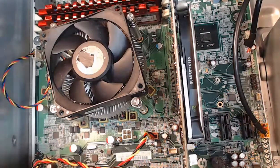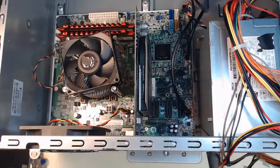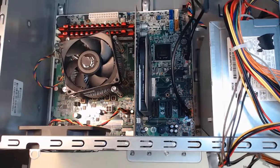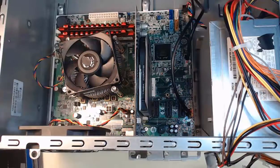We're going to zoom out a little bit and take out some adapter cards to finish off our disassembly. We've got one adapter card here — our video card — and we're going to remove it. In order to remove it, I need to take off this mounting bracket. When I remove this mounting bracket, it will allow us to lift up and pull out this graphics card. I'll take my screwdriver, grab that screw on the mounting bracket, and unscrew it. With that unscrewed, I can lift this off — it secures any cards so they're not going to shift or be removed.